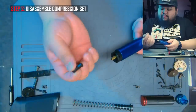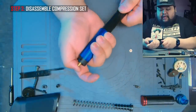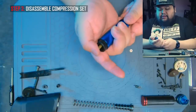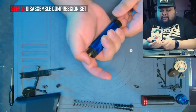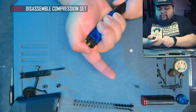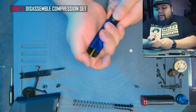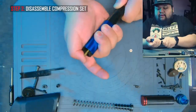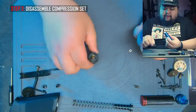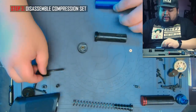Press it down — you want to be a little careful. Don't put too much pressure on the cylinder head because you can push it inward, but you want to put enough so when it starts to release air it's holding it in place. Yeah, there's still a lot of air loss here. So there is leaking in a few different areas. What I'm going to do is completely replace the stock set with aftermarket parts.